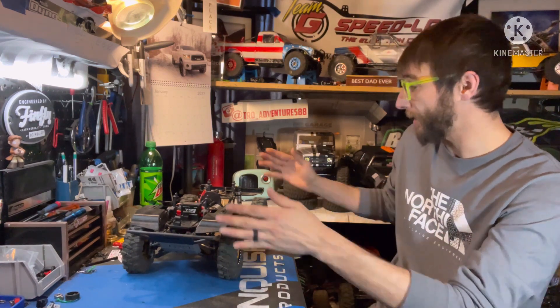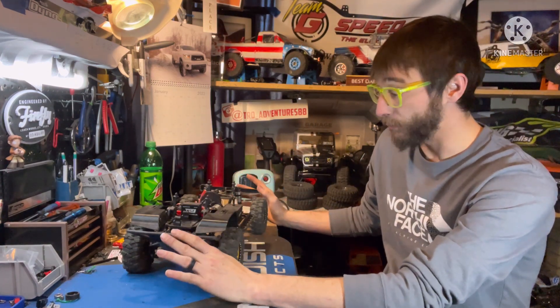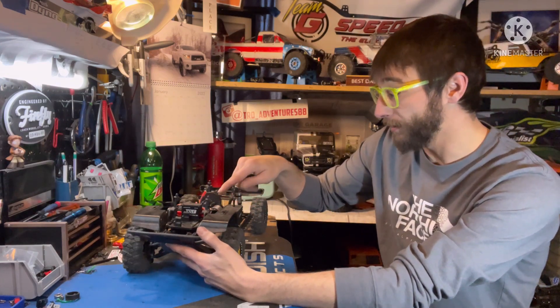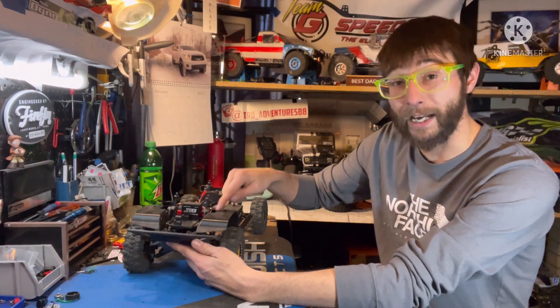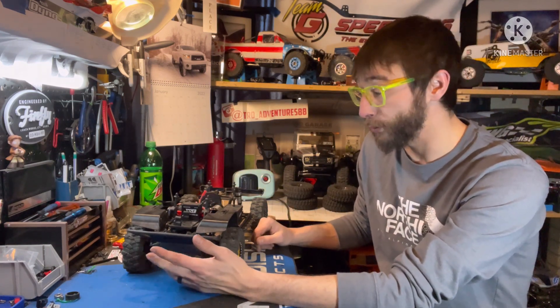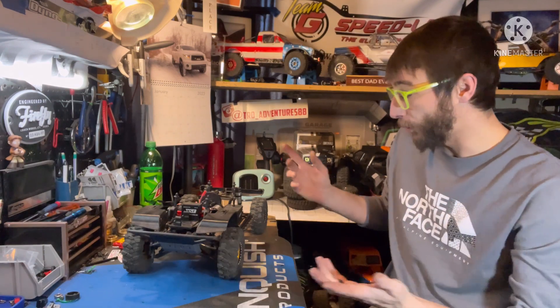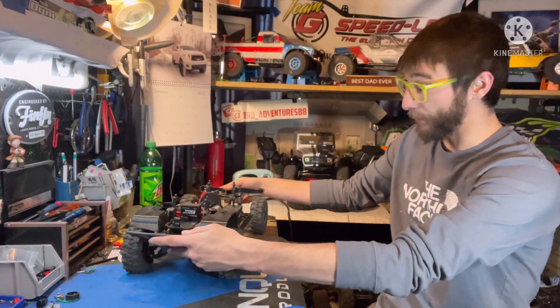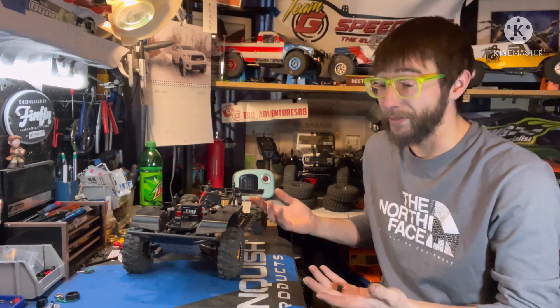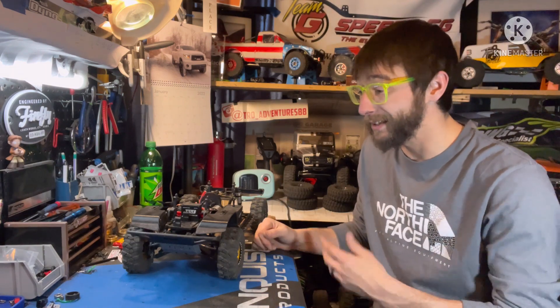With that clearance gain it does sit up a little higher, but if you don't like the ride height you can simply take off the drop-down bracket for the IFS shock and bolt it to the shock tower like a normal shock. I've left mine as-is — I think it hits the look and height exactly where I want it. Overall it's a nice affordable kit and pretty simple. The initial install took me about 10 minutes.